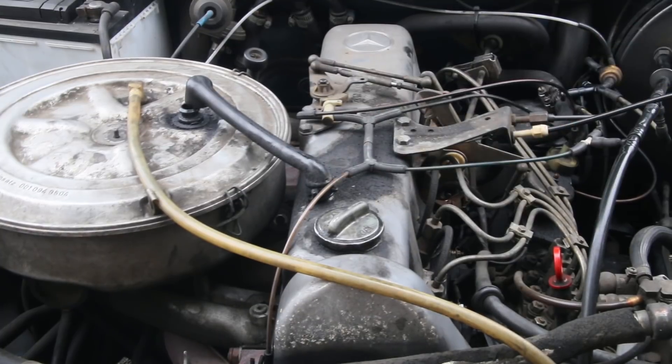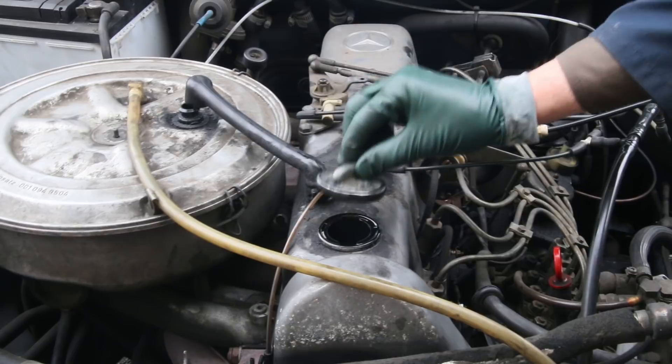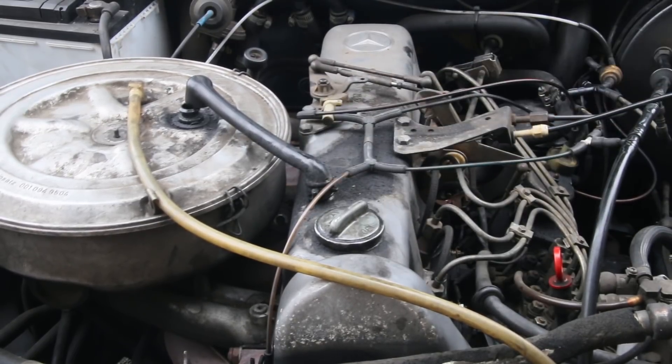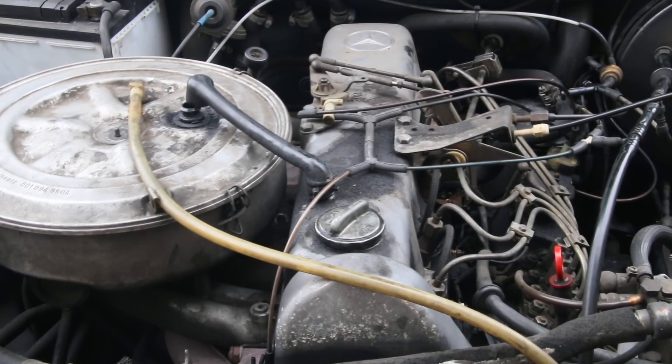Right now the engine's cold and you can see the cap is just barely moving. I can see a little bit of smoke coming out, so I've got a little bit of blow-by with the engine cold. Some have said, well, I thought you were supposed to plug the breather when you do this test.